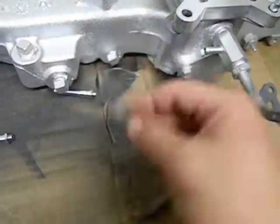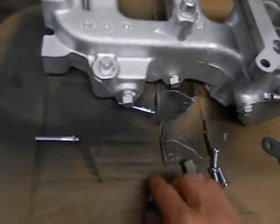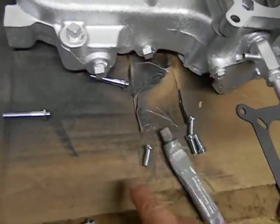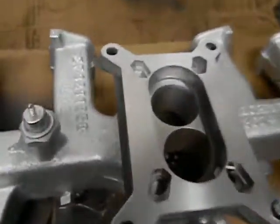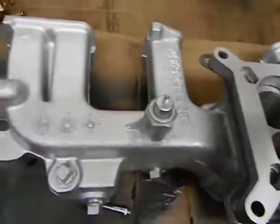So you're going to put that in there and line up your bolts. They came with these, and you're going to want to use lock-tight because you're going steel into aluminum. A Phillips head is notorious for stripping if you ever had to pull these things back out, so lock-tight those up. Those are going to go right down in these slots right here.